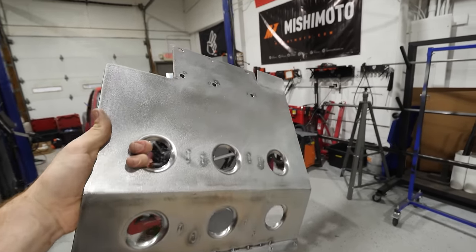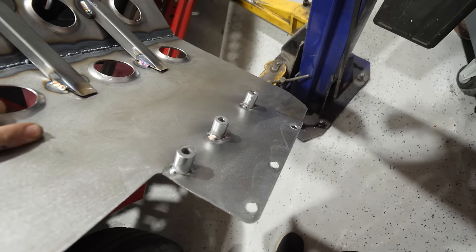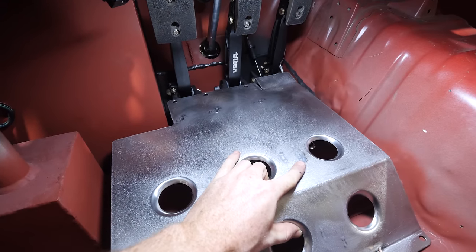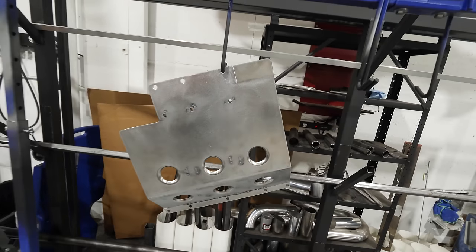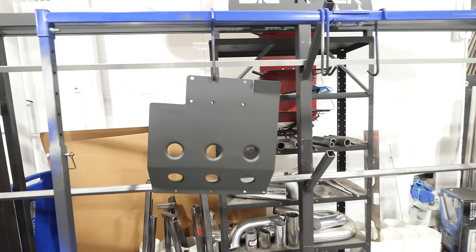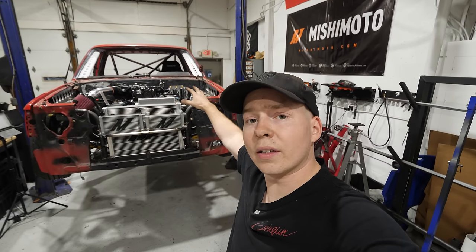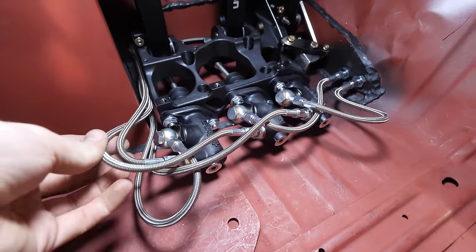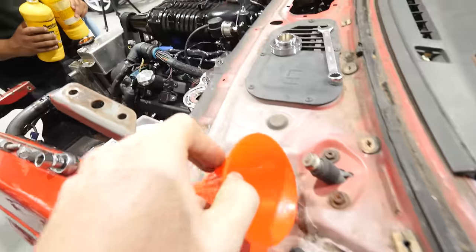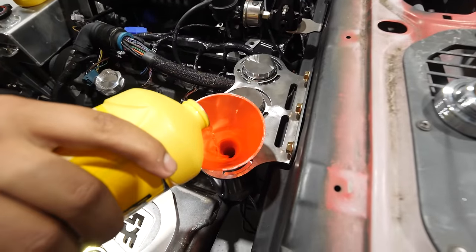Here's the final piece — six little dimple dies, a nice flat spot to put your feet, some bracing on the back and step-offs on the back to make it all nice and level. This just turned this truck from a born-old-looking street truck to a freaking race truck, but it's still streetable. I bolted it down, hopped in, felt it with my feet — feels awesome, nice and sturdy. We're going to paint the plate so we can put some grip tape on it. I got all the remaining lines and fittings, so we have everything plumbed up including the clutch — kind of looks a bit like spaghetti, but it should hopefully work. First fluid going back into the truck: brake fluid.